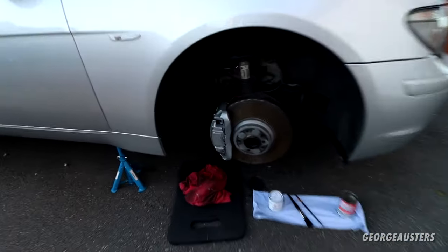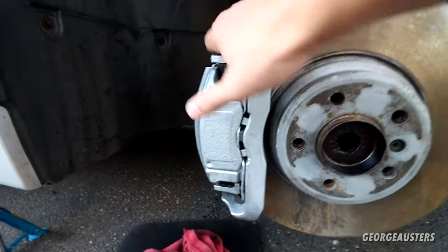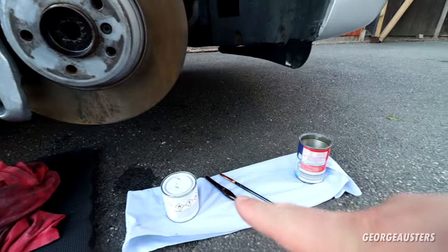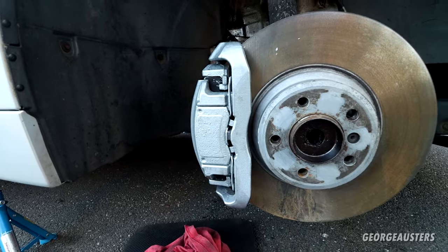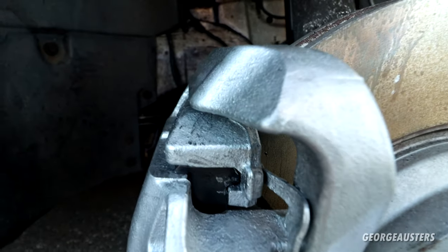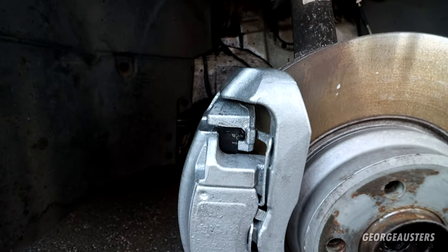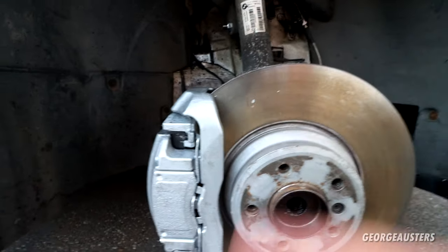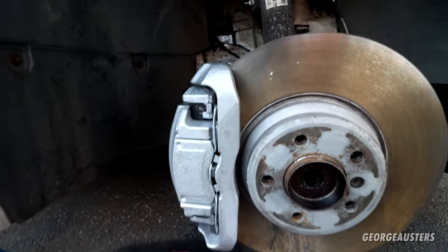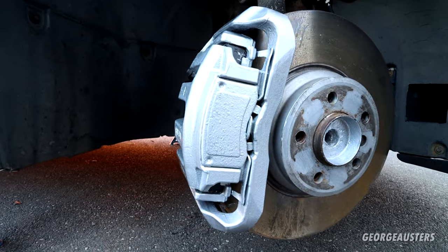I did say I thought this was water-based, but I tried to wash it off my hands with water and it didn't come off — needed white spirit — so it is in fact oil-based. It's going to take quite a few hours to dry, so I'm going to leave it a full 24 hours then come back and give these another coat. It is in fact 24 hours later now — the first coat has completely dried, no tackiness at all, and we're ready for the next coat.